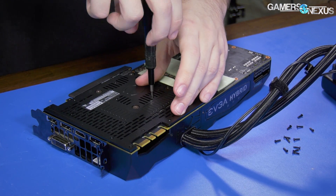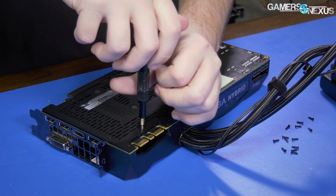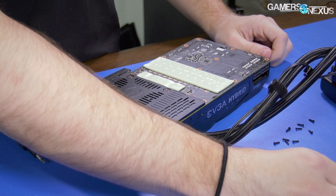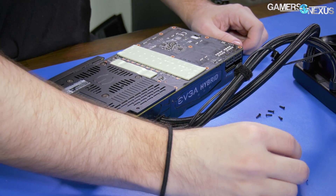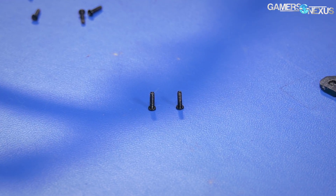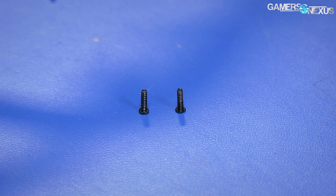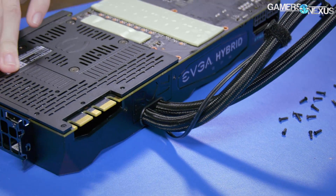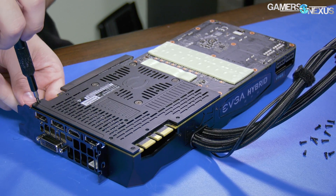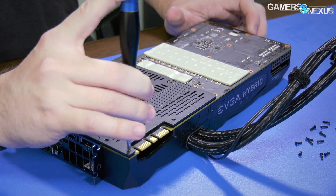These screws - there are two different types of screws in the backplate. I've heard through EVGA that this might change in the future for the next design. The two types have a different thread count - one has fatter threads than the other. So it does actually matter where you put them back into the card; some of them won't fit in other places. I think the ones with the fatter thread count go all the way through to the shroud and the base plate because they screw into plastic, and the ones with the thinner thread count go into other elements on the other side of the PCB.